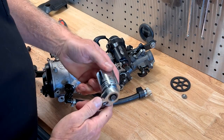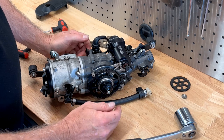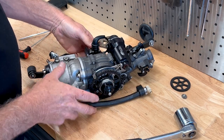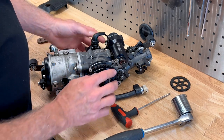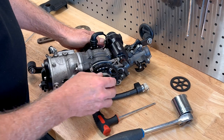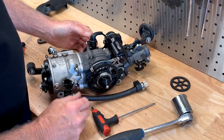From there we use a 32mm socket. JetSurf has a special tool that holds the coupling at the back. One thing we should do before we start is test these bearings. This bearing is working fine in the board, so all we need to do is check it. See how it's freewheeling comfortably one way, then turn it the other direction — it's locking, and you can see it's locking really well. That's working as it should. If the clutch isn't working right, it will freewheel both directions, or it can actually lock up so as you're turning the flywheel the crankshaft turns both directions together. What you're looking for is smooth one way and locking the other — if it's locked or freewheeling, you're in trouble.